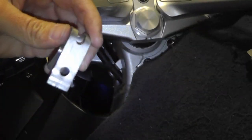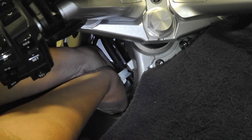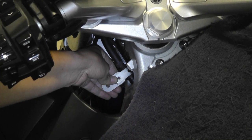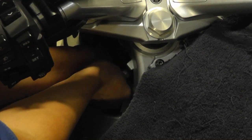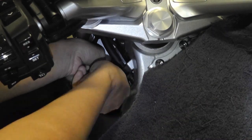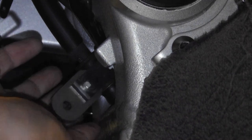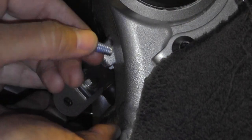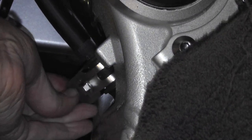I'm going to put it back on the clutch hose. Then you're going to fit this bracket in the threaded side, put it in between the clamp, and screw in the original stock screw. I put some blue Loctite on there. Then I put the clamp on the extender, put blue Loctite on this screw, put it into the unthreaded hole, and screw it into the hole on the frame where the original bolt was attached.